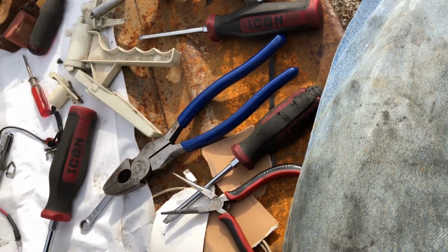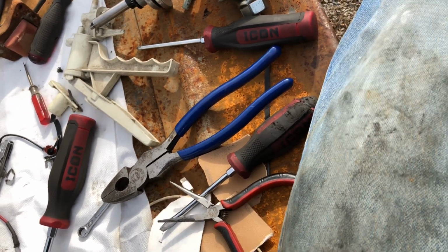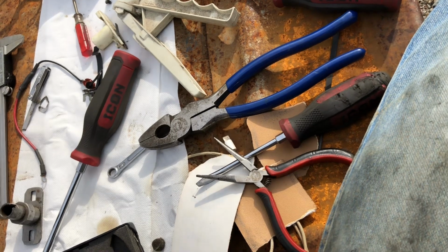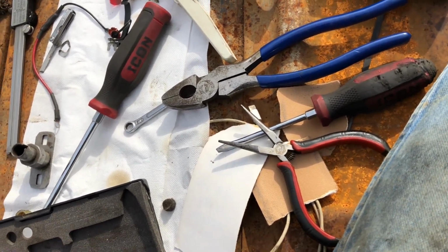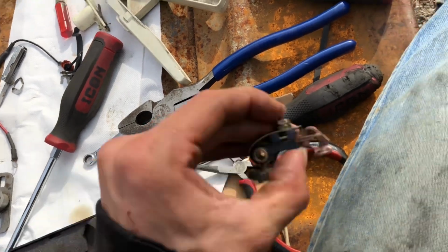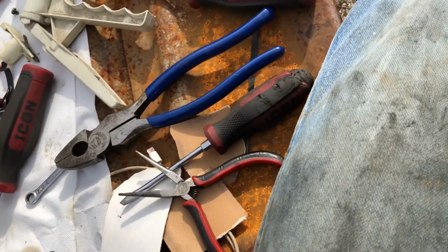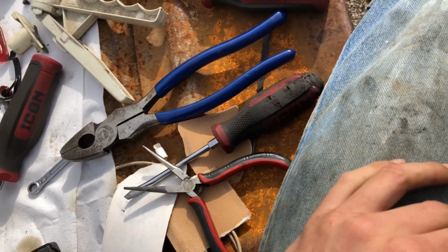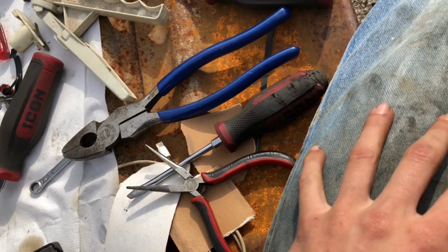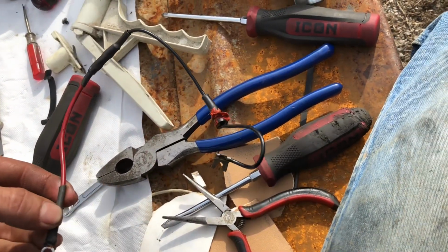I don't know, 15 didn't seem to be pretty good, but I did mess with the condenser, so I don't know. Might go back up to 18. Do it with 18 on the feeler gauge, and then check, see what the dwell is, and go directly with the dwell. If it's close enough to the dwell, I'll just leave it. Wire connections look good. Don't have really any problems with that.